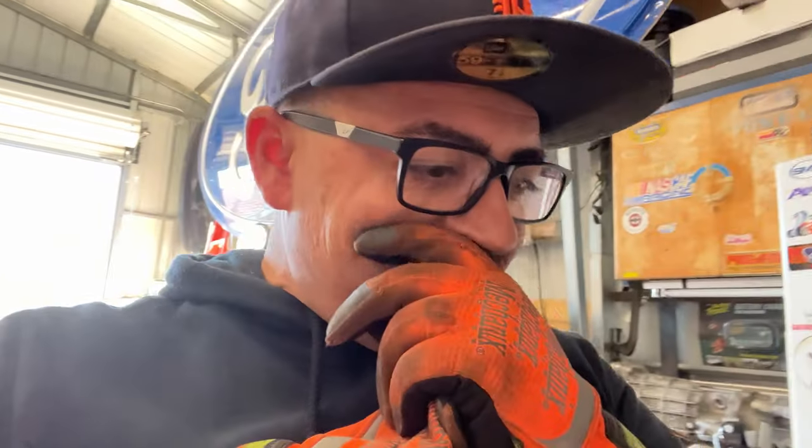Those freaking wheels are hard to get on, man. I think when this car is finally together, this thing has the screw-in studs, 5/8, and it looks like before they ran from the back. But I'm gonna see if somebody makes one that I know they screw in from the front, something that's got an Allen key. And maybe I can get the wheel up in there and then screw the studs in, because it's a pain in the butt to get it all over everything.